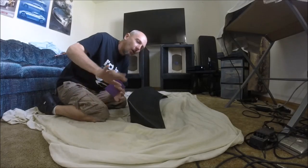Now I'm going to get this thing sanded and under primer. You might be thinking why not take it straight out to the car and prime it afterwards — but I'd rather get it primed now, let it fully dry, then get it on the car, drill the holes, get everything prepped and ready, then re-sand, paint, and clear coat. I use acrylic enamel, so you can get away with 320 sandpaper, which makes life a lot easier and it'll take about 20 minutes. If you're NOT using acrylic enamel, don't use 320 — it's too aggressive.